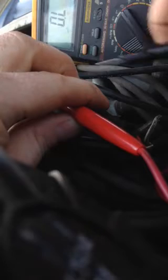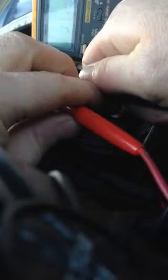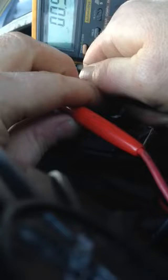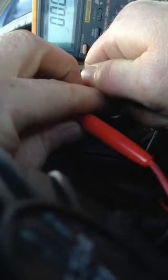Going to the third one here that runs cylinder number three and six. It's reading 0.5, 0.3, 0.4, 0.5, 0.3 — it's fluctuating all over. So as long as I'm solid on the contacts and it's fluctuating like that, I'm gonna say that's bad. I'm on these contacts pretty solid without shaking and this thing's all over the place, never higher than 0.4.